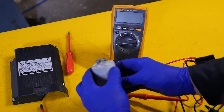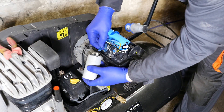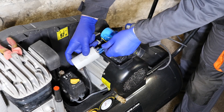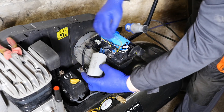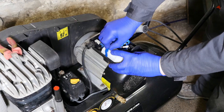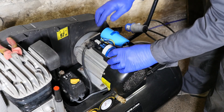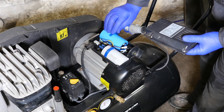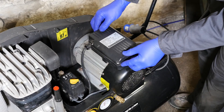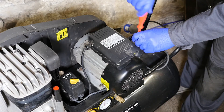There may be a little bit of life left in this one. I'm going to pop that capacitor back on. Although technically it's failed the test, I don't believe that to be the cause of any issues, because the compressor does actually run properly — the issue is getting it to start. So I was looking for the issue being on the starting capacitor. I'm going to pop the cover back on and screw that all up. I'm thinking that's a pass, but there's another issue.